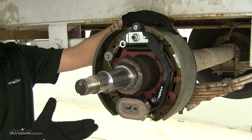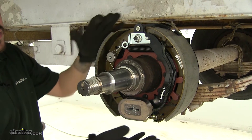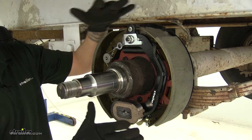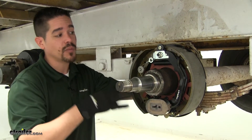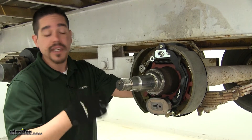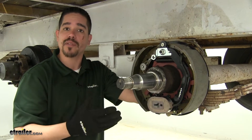Here's what our brakes are going to look like. The really nice thing about this set is that it's going to be a complete unit. We're not going to have to worry about replacing springs or individual pieces — it's just going to be a simple bolt-on design. Our brakes are a self-adjusting design, which means that once we have them set initially, we're not going to have to crawl underneath our trailer and mess with adjusting the brakes, because they're going to do it for us.